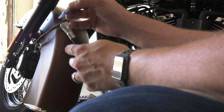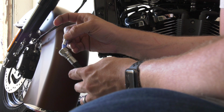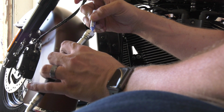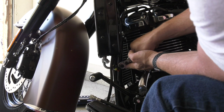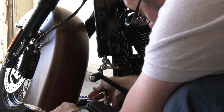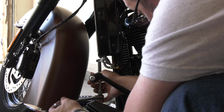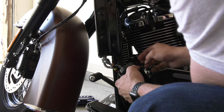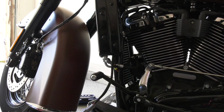That is the other thing that you really need to have in order to do this appropriately. So once you have that plate on there and your oil cooler is all snugged down, then you can run your oil lines. Again, Loctite everything, get it all set up, snugged down. They provide you the little wrench that you need to tighten down those oil lines. Really nice setup. Tighten all those down, and then put your oil filter on. That's it as far as the actual hardware part of the installation.